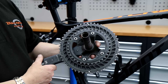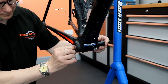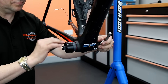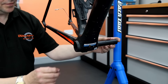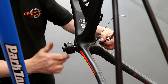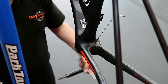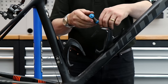I'm going to remove the bottom bracket bearing — I put my extractor in there and extract it out one side at a time. Out comes the drive side cup and bearing, then the non-drive side cup and bearing. I'm taking these out before I clean the frame down; it will also help with cable routing to be able to get into that bottom bracket area and check that it's within tolerances and ready for a new bottom bracket.